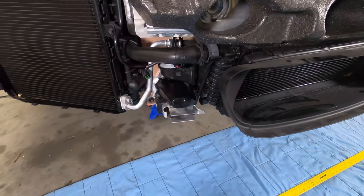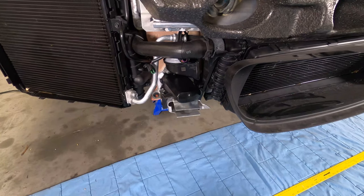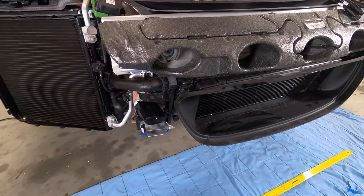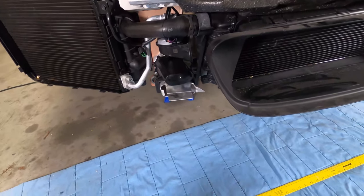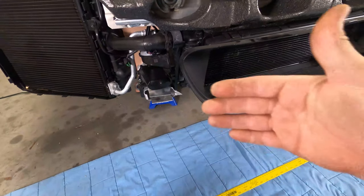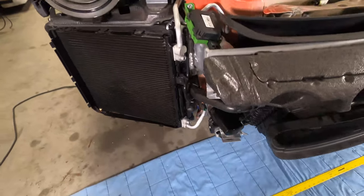We did get our radar in here. It does take some time building these brackets and shimming them up. I mean, these things have to sit absolutely perfect. So 0 degrees level to the ground, which we pre-measure prior to putting it up on jack stands. Then we have to use a stick across to make sure that we get it all set up to where it's straight with the front of the vehicle. I mean, it's not as simple as you think. So we have to get crafty.